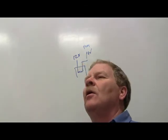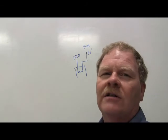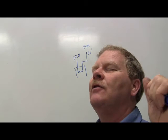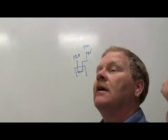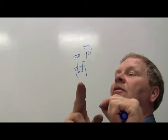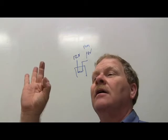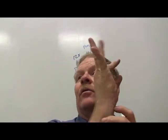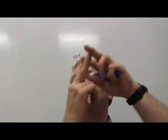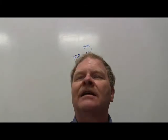So me and Daniel, what I like to do, and let me hit you with this while I'm still thinking about it. Everybody's had an old oxygen sensor in their hand that they just changed out, right? If you cut this connector off the oxygen sensor, and you've got the connector that's come off the oxygen sensor, and you got your wires waggling, right? Okay, I'm going to get me a light bulb, and I'm going to hook it between the 2 wires that are the same color. That way, I've got a way that I can check that heater.